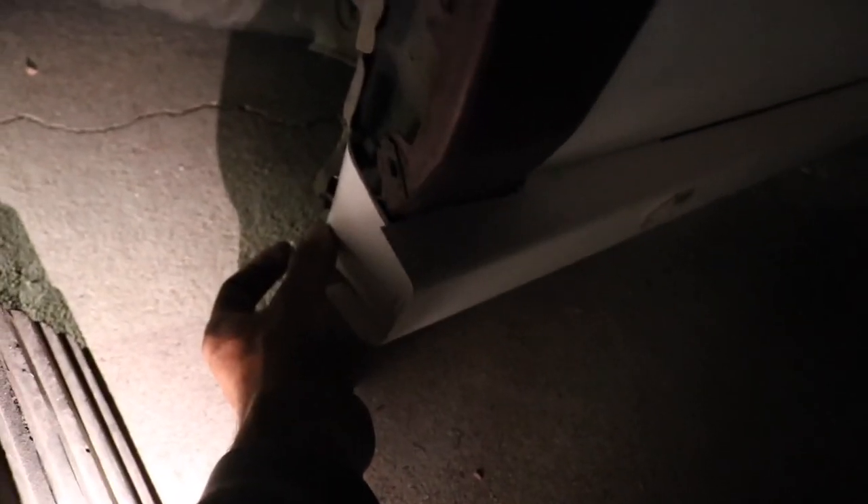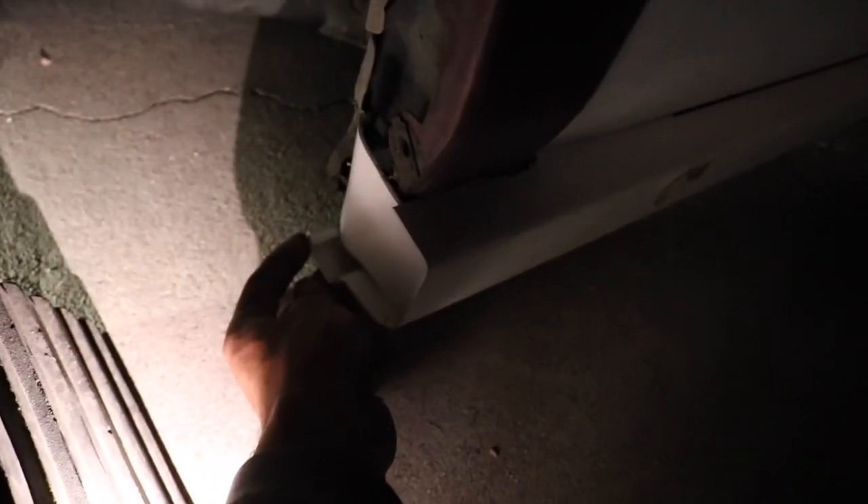The end cap serves two purposes: one for aesthetics so it doesn't look like a rain gutter from the side, and two it'll help me bolt it up to the fender and push it out. I have this lip right here that goes all the way down but had nothing attached to it, so now with the end cap JB welded in place I'll be able to push it back, drill some holes, and either zip tie or self-tap it in place so it can't go back in. I'll JB weld them in place so I know the depth, cut off the excess with a cutoff wheel, and sand it down smooth.